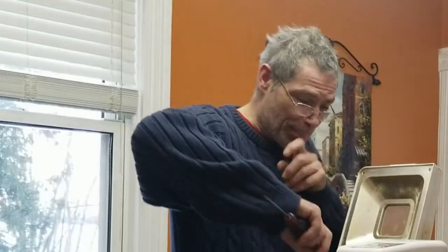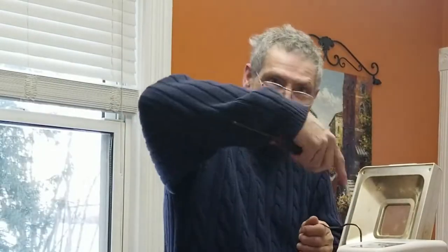The problem we have with the bread maker is that it starts to do its kneading — the little paddle inside starts turning around and actually kneads the dough. It gets bogged down and the gear stalls. The motor keeps turning and all you're hearing is the banging, bang, bang, bang.